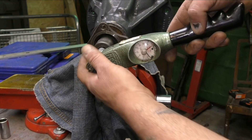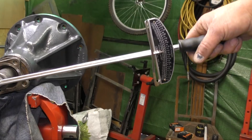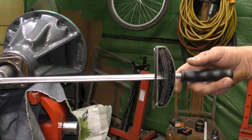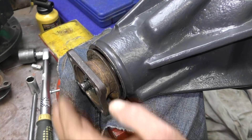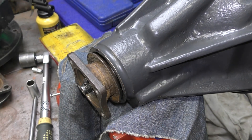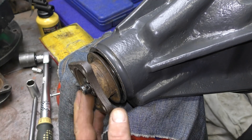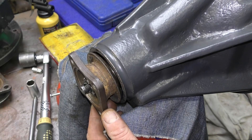I can appreciate some of you going, oh God, this is a little bit too complex — but get your head around it and become a little bit of a measurement anorak. Because we're Land Rover owners, we shine a little bit above all the other DIYers. So if you put your shims in and you've got this sort of play, it's absolutely no good and the shim is too thick, because it's allowed too much space between the two bearings.